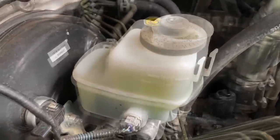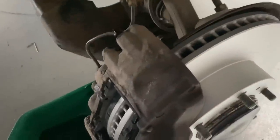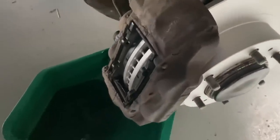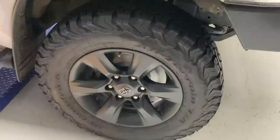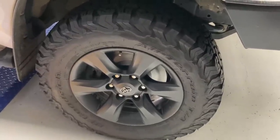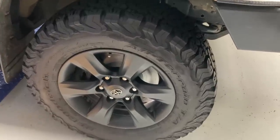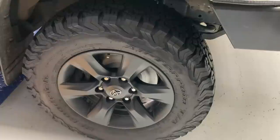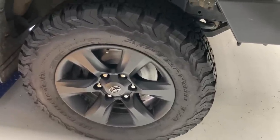Now that we've sealed all that up, it's time for a bit of a clean up on the outside. Remove the drain tray and we're going to give it a quick wash down, followed by more of a wash down later outside — like a car wash type wash down. Wheels are on. Don't forget your torque spec — about 110, 115 newton metres. In some books it's 108, 113, different models. As long as you're around the 110, 115 you're laughing — not too much more, not too much less, everything will be okay. Double check your mind: you've not forgotten anything.